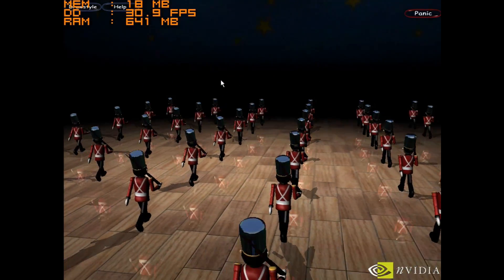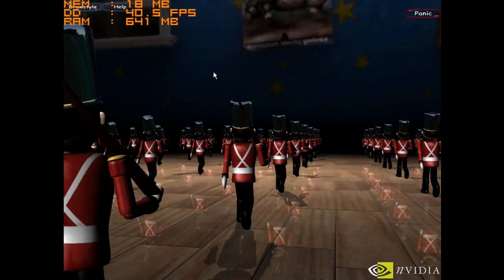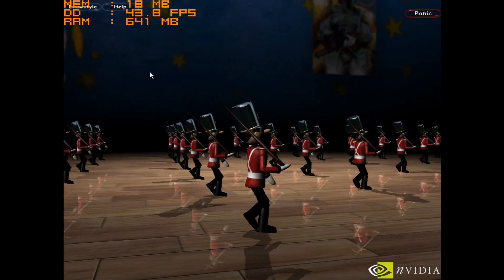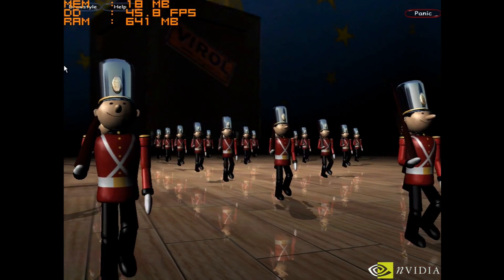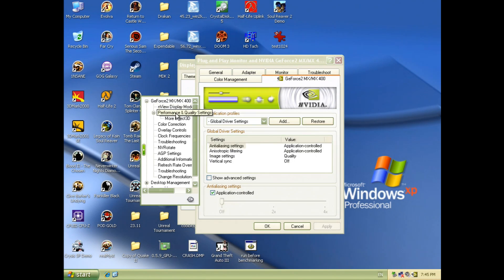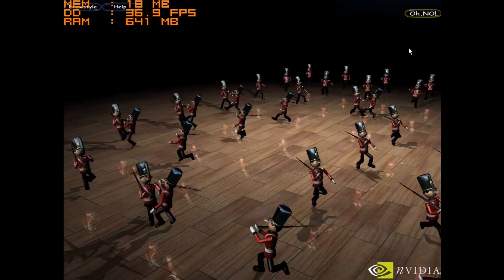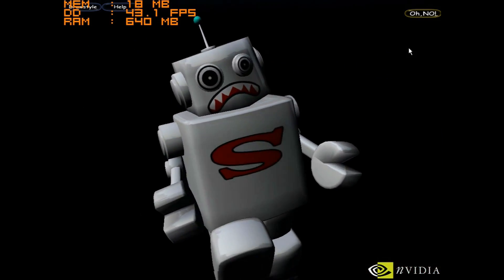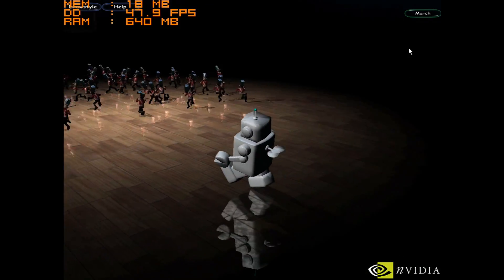The GeForce 2MX has all the features of the full GeForce 2 GTS, such as AGP4X support, the Nvidia shading rasterizer, and the HD video processor — although slightly less capable. It also introduced TwinView support for driving two monitors or a monitor and a TV, and it also introduced Digital Vibrance, which can make your picture look a little bit more vivid. A lot of these GeForce 2MX cards have passive cooling, and you also have to compare the outputs in terms of VGA, DVI, TV, and so on.